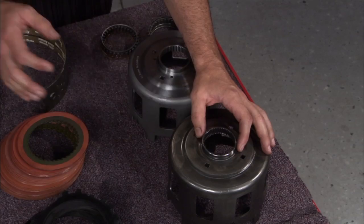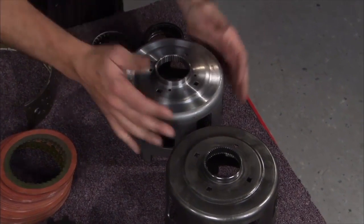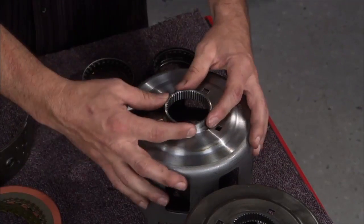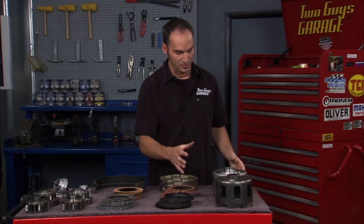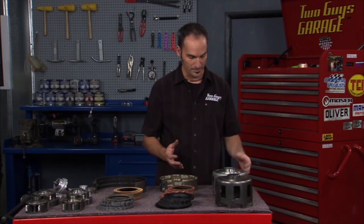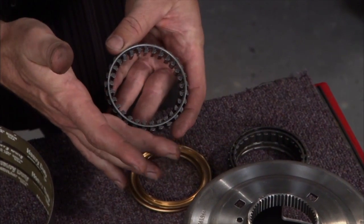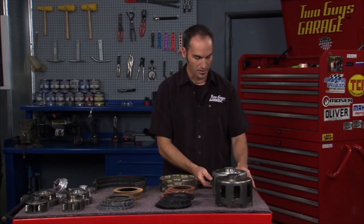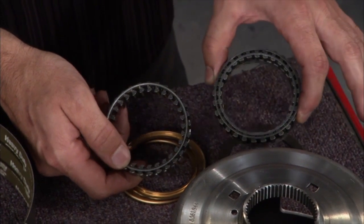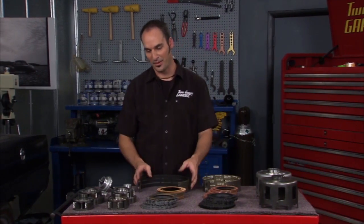The sun shell is a known weak link in this design — this serrated ring will actually break off. What Monster does is use a thicker gauge cage and weld an extra bead on the inside spline ring, then machine it back down. This thing is going to handle a ton of torque. They don't stop there — even the sprag is upgraded. A sprag is kind of like a one-way clutch: go one way and it allows a slip, go the other way and those little members bite and lock. The upgrade has a double cage with beefier inserts. I'm getting excited to get this thing together and go bang on some gears.